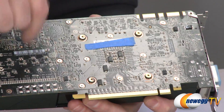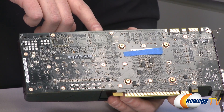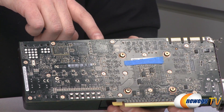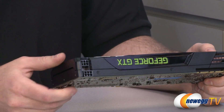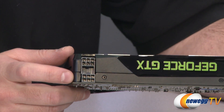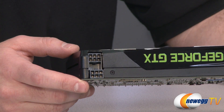Scattered around the card is your integrated GDDR5 memory — you get two gigabytes of that, running at 1.5 gigahertz on a 256-bit memory interface. For power, here are the power connectors: you need two 6-pin PCI Express power connectors, which fits within that 195 watt TDP.